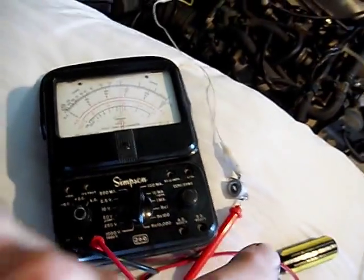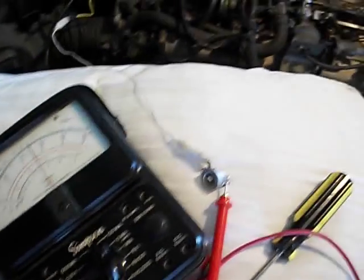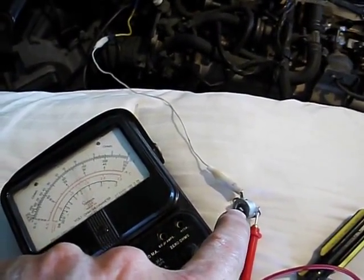I'm going to take the meter out of the circuit because as far as setting that rheostat, I want to take this resistance out of the circuit to make sure I'm getting as close to what I should be reading to get 185 degrees. Let's take a look at the gauge real quick.